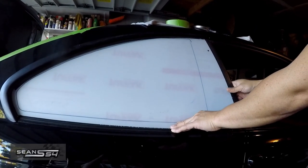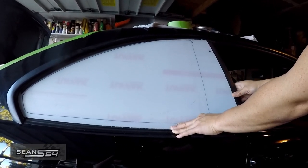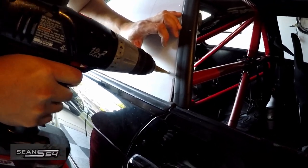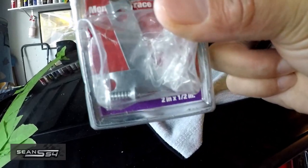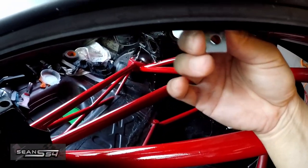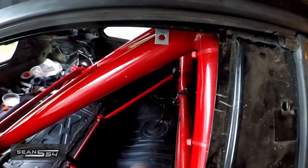Doing some research, they don't recommend using a riveter or rivet gun. Even though there are videos of people installing Lexan polycarbonate with rivet guns, the riveters can put a lot of stress on the polycarbonate and lead to cracking. So I made this little L-bracket — you can buy flat brackets at two and a half inches or L-brackets as well. I'll drill one side to the back of the car and that gives me a little area to put my bolt through. Here's my little L-bracket with a self-tapping screw to tighten it.